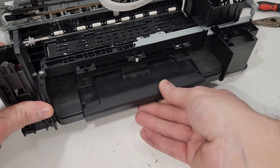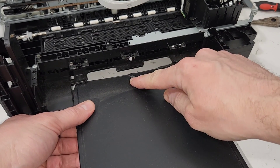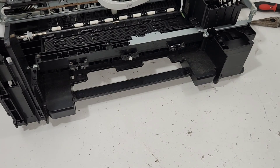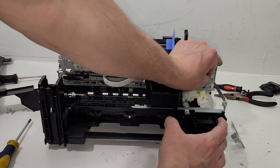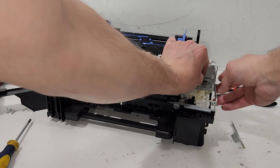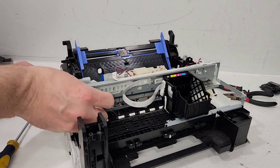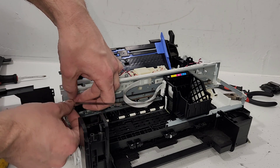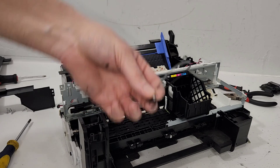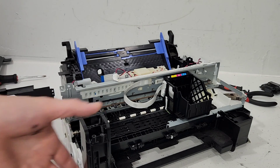This main paper output tray that we missed — we can remove that one. If you push right there and keep sliding it, that releases this tab right here, and you have your paper output tray. Also that timing strip right here — it's connected to this hook right here. You can just disconnect it there, push it to the right, and take it out of that groove or hook. Kind of pick it up, get it out of this thing here, and then remove it with the spring. Remove that from this little hole right here.